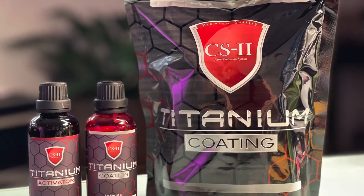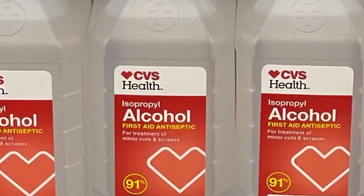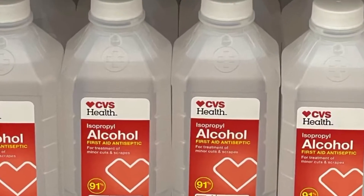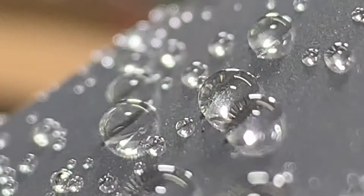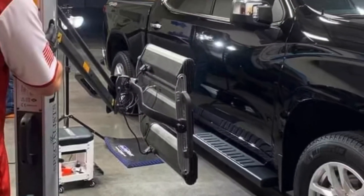You can apply more than one coat if desired, but only one solid coat is needed. Never apply alcohol or IPA to titanium self-heal because it will negatively impact hydrophobic performance. SH has a lower chemical resistance than titanium hard. Do not wash for 24 hours. Allow coating to fully cure over the next one to two weeks unless cured with IR.